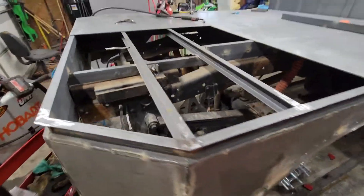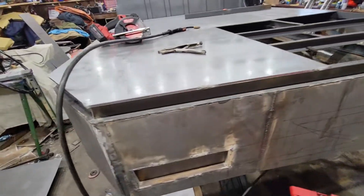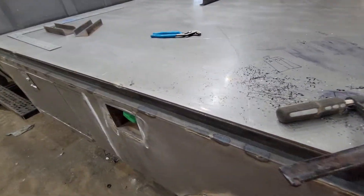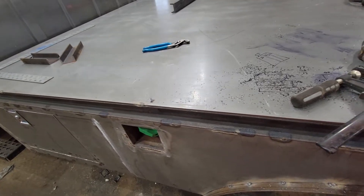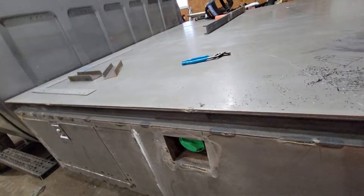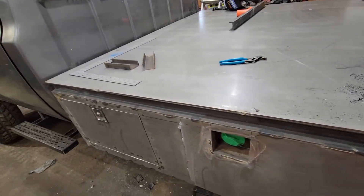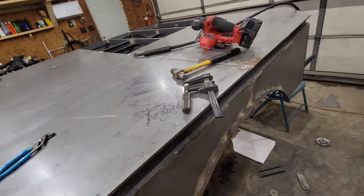The boxes aren't completely sealed yet — I'm going to wait to put that piece in until I get everything tacked and welded, so I still have access to it. If I was doing it again, I would take the C-channel, flip it on the inside, then put a piece on top of the plate for all my tie-downs. I think once you start tying stuff down it's going to chip the paint — it's a farm truck so it won't be a big issue, but it's something to think about.